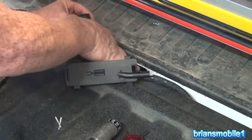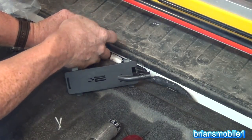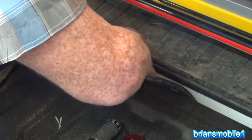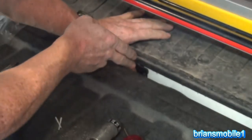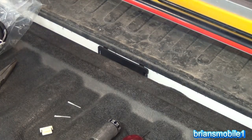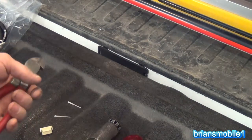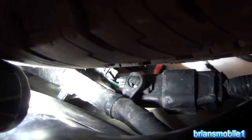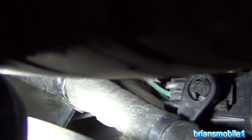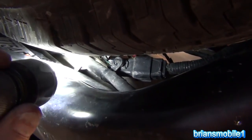You've got this extra one hanging off of that — the retainer that keeps it all together. It's alive! Alright, we're all there and we're clicked in, so it should be able to lock and lock the tailgate. Tailgate works. Lock the tailgate — tailgate doesn't work. Unlock. We're good — thank goodness for remotes. The harness for the power tailgate handle comes down to here, and then you just have those two green wires. Everything else is deleted on the tradesman as shown here; it just makes a little commute from there to there. Those two wires run all the way up to the front.